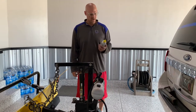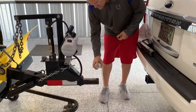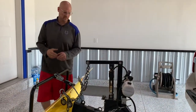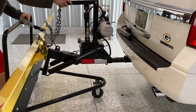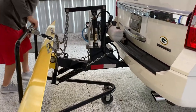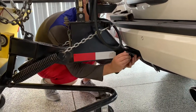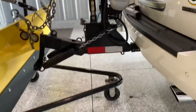What I usually do is use this Blaster silicone spray — this just helps the stinger and the receiver. I just do a little spritz on each side. Usually you're putting the hitch in with no weight on it, but this has a little bit of weight on it. So we just go ahead and line it up, adjust it however necessary, and get it in a little bit at a time until it lines up just right. Then make sure that it is secure, and come around the other side depending on where you have the harness mounted.